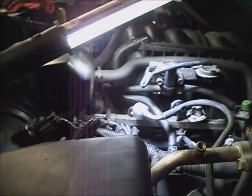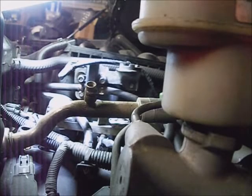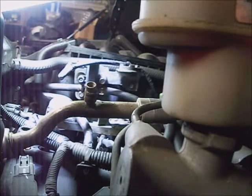And then next I want to watch this fuel line connection. Turn the switch on again. Look for any fuel dripping out of it. If not, go ahead and try the starter out. I don't see any fuel dripping out, so I'm going to go ahead and try the starter out. It works as advertised. There's no missing, so there must not have been any chunks got down in the cylinders.